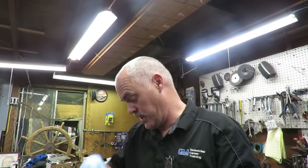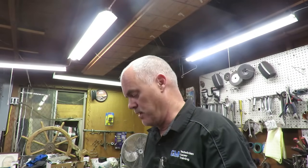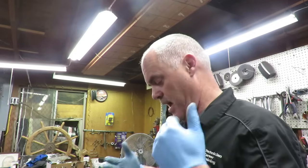And it doesn't matter how much money you save, if a thing is full of grime and dirt and the oil galleries aren't clean, your engine's going to have a real short life. So when I say, hey, let's do an extreme budget build, we want something that's going to last, right? So we did a few reliability things, like making sure everything is spotlessly clean, making sure that we put new valves in the head and so forth. Spend a little money on that stuff, because those are critical areas that are going to cause longevity problems with the engine. So cleaning is just absolutely important.